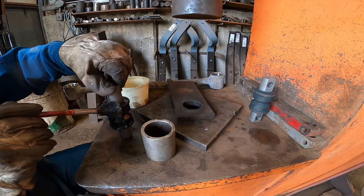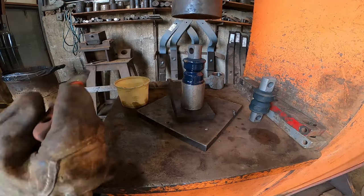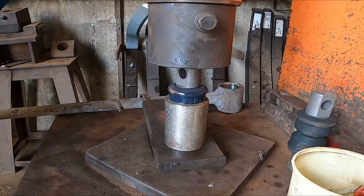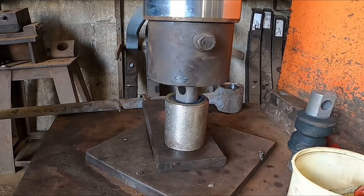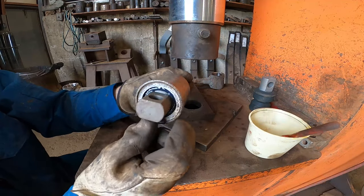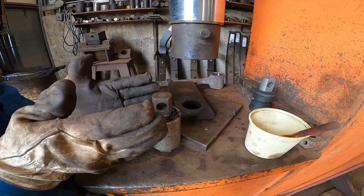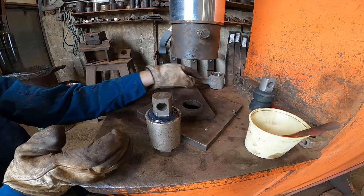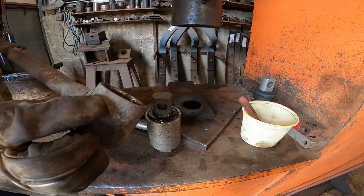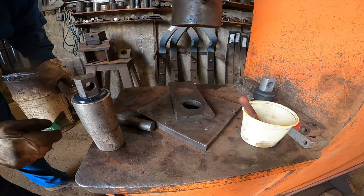I put a little bit on the top edge here. What we're going to do is push them into this little cartridge. You can see it's more open up top and more enclosed at the bottom because it has a reducer inside. So as we push the bushing inside, it'll reduce it in size so we can get it inside of the torque rod. There's our punch mark right there - we're going to line it right up to that. That's why I punch them on the outside so I can actually see it when I'm lining up my bushing.